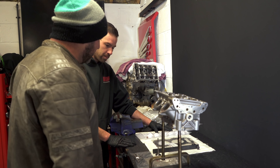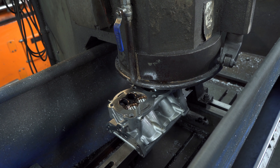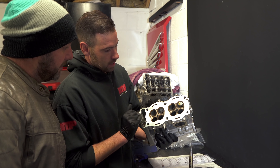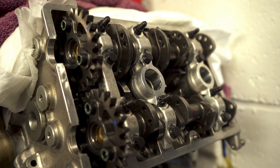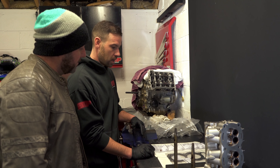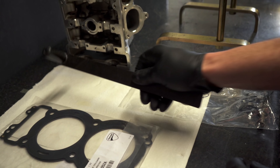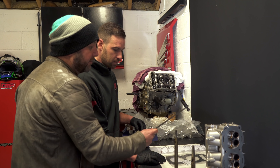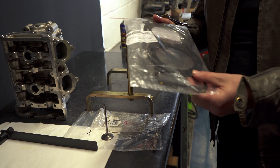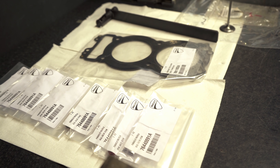Show me what we've been waiting on — show me the bits. So we've got basically everything that we need now. Head gaskets — the heads have been skimmed, they've already been done. We've got basically 16 oil seals, and I've already built one head assembly, so that's on there ready to go. It's so long-winded it's ridiculous — the check-and-clear process, special tools from Ducati, all that kind of stuff. They just don't sit on the shelf, so you need to order them, which takes time. A head gasket for a Desmo isn't something you're going to get at your nearest Halfords.